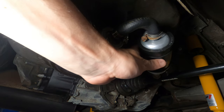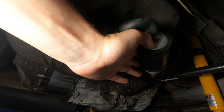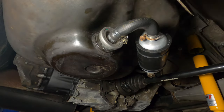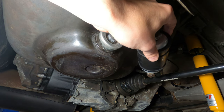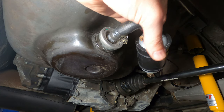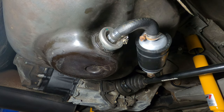This fuel pump is essentially a motor that sits in its housing and spins a metal carousel around. It has some cylinders in it that force fluid through the pump. When the pump fails, the car basically won't start and won't run. They can be easily tested just by applying a jumper to the fuse panel where the DME relay sits — it's an easy item to test and easy to replace.